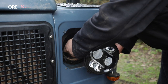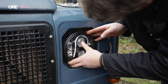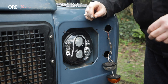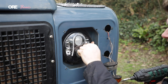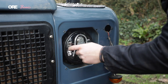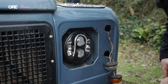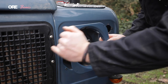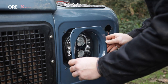Just feed that all back in there, and then all we have to do is slot it onto the old screws as it was before — and there, it sits in. All you need now is the extra screw that came with it and your screwdriver — put that one in there, simple. That's really cool, loving the way that looks. Just a note: make sure when you do it back up and put it back on, the bolts top and bottom have a little groove in the end. It sits in that channel so you can adjust it for the MOT, so make sure you do that. When fitting these, have the grooves top and into the grille, because that's where the two bolts to adjust it for the MOT are, and it leaves those available to be tuned up.